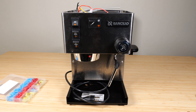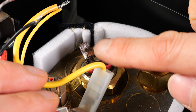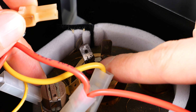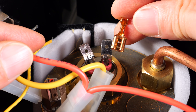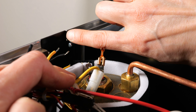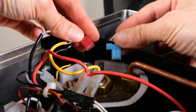I'm actually trying to fix my Rancilio espresso machine. There was a spill on top and a little water leaked in and got pulled into a connector — I smelled some plastic burning. The connector is singed and yellowed, and the one right here is really bad — it basically turned to charcoal. I have a straight crimp, but the panel that sits on top would cause interference, so I can't use straight crimps — I have to use right-angle ones, which is why I bought these.